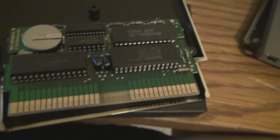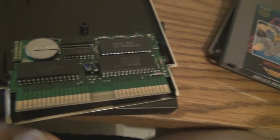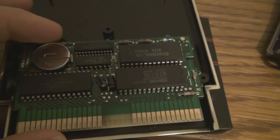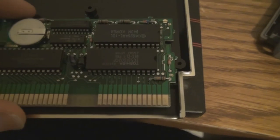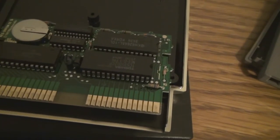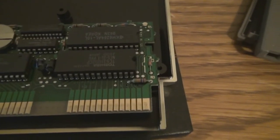Because the RAM used in these cartridges has volatile memory — just like the RAM in your computer — RAM can only save data if it has power. Once it loses power, it loses all of its saved data. I've tested this on my NES and played it for a while; the battery still works fine. This game was made in 1985 — it's older than I am — but the battery still has sufficient charge to keep the RAM from losing its data.